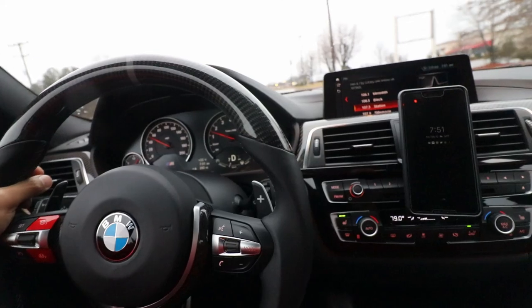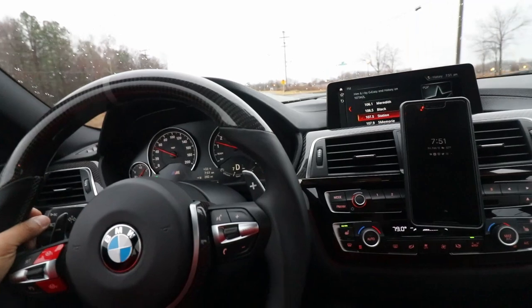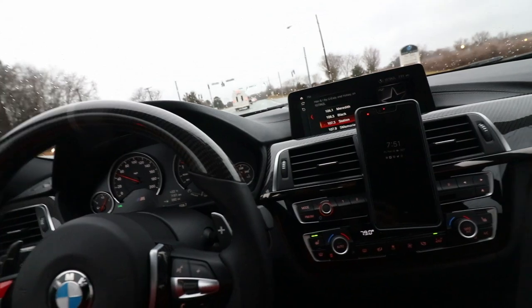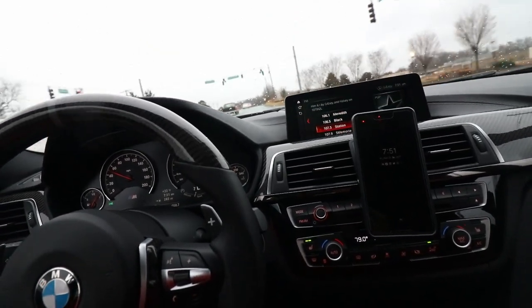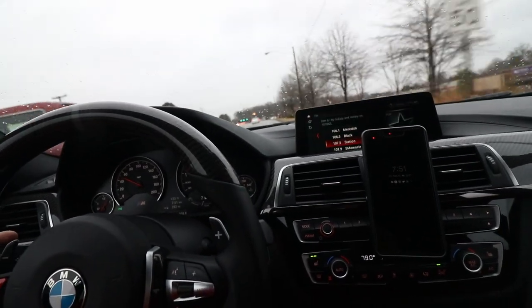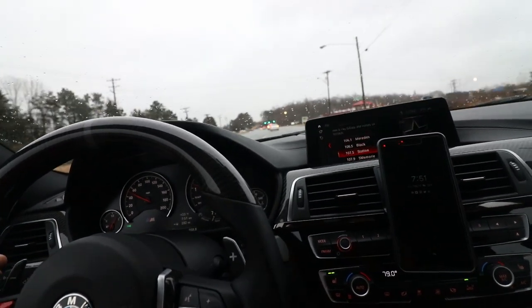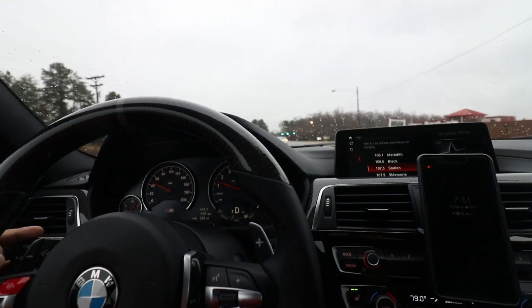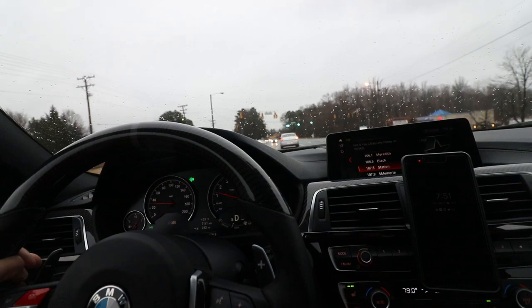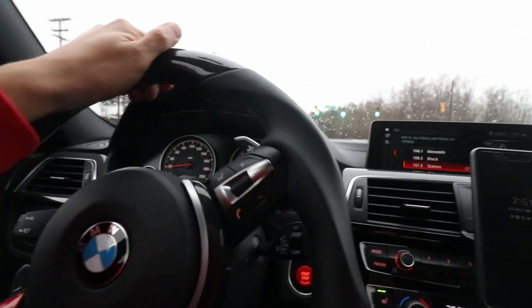So I'm picking up the video a couple days later after we did the install. I did the rears and then I had Miguel come by and give me a quick hand on the front ones. Honestly, it was one of the most simple installs that I've ever done spring-wise. I didn't really record it, but to give you an idea of the method, I never took the shock out of the assembly, out of the control arm. All I did was loosen a few bolts, undo the end link, and release the top hat bolt, and we just dropped it down and it came out.